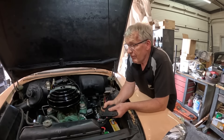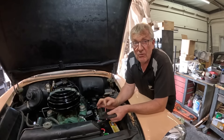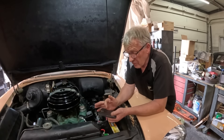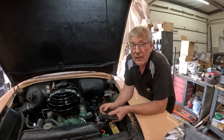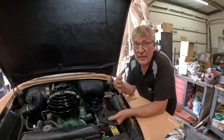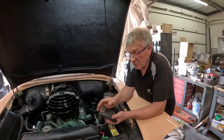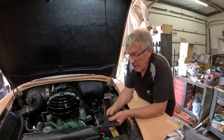But it just dragged the job out another couple of weeks, and that one almost fitted — we just had to modify and remount a couple of the holes to make it fit. We also had to modify the chassis to allow the steering box to actually fit flush because the bracket was riding on the chassis.